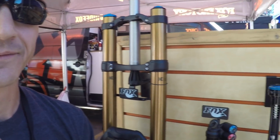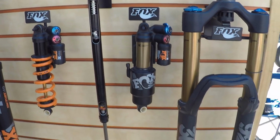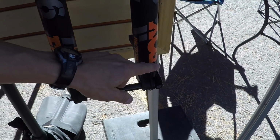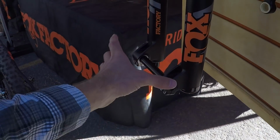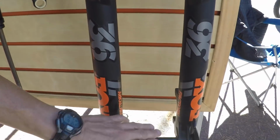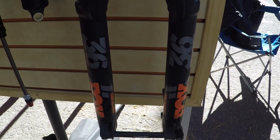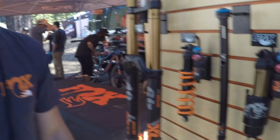Questions here. I love forks. I love suspension. I'm all about comfort. So I wanted to go through some of these parts for people. So this is a thru-axle, 15 millimeter. Yeah, thru-axle, and we call it quick release thru-axle because it's got the lever. As opposed to bolts. Bolts, are those just sturdier because it's a downhill fork? It's going to clamp it a little more solid, a little more handling. This one, it's just a lot more convenient. Yeah. You're changing a flat. The little bit of stiffness you might get, people aren't worried about it because they'd rather just have the quick release. For sure.